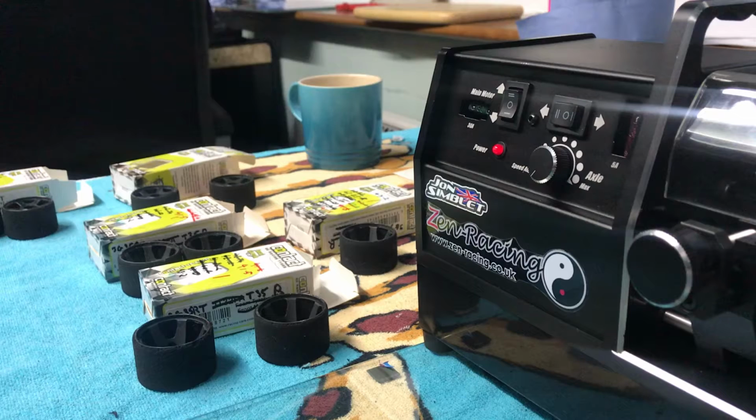So I balance having the maximum life of the tyre and making my life easier by having them similar sizes, by using this procedure. It means that I'm not constantly chasing ride height and forgetting things at a race site, because all my tyres are the same size,